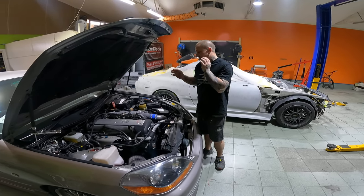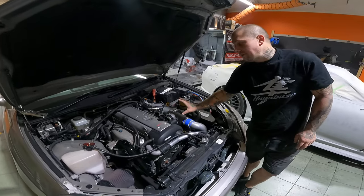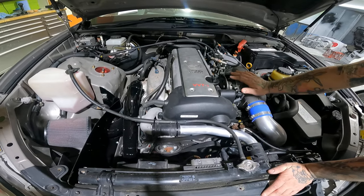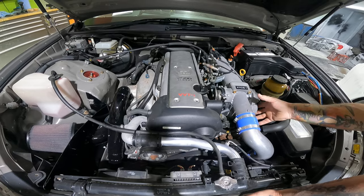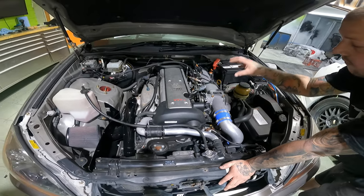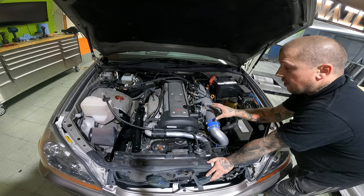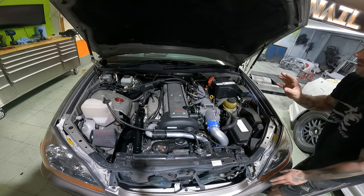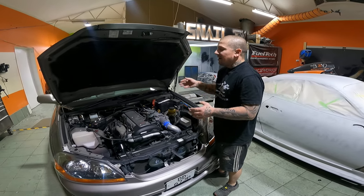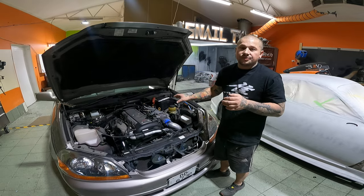We did notice one thing when we started to do this — I've never actually done the 110. This one has got an electronic throttle body. Unfortunately it's not drive-by-wire; it's still a cable throttle, but it also has an electronic motor in there which activates the throttle itself. The throttle is used for traction control and cruise control, and if anything goes wrong it will shut off. We don't want that. I was going to fit a drive-by-wire on there, but because he wants paddle shifts, there are so many outputs that we're just going to do a manual throttle body.